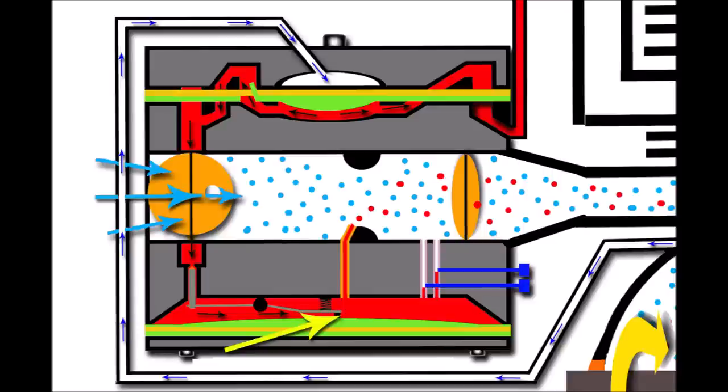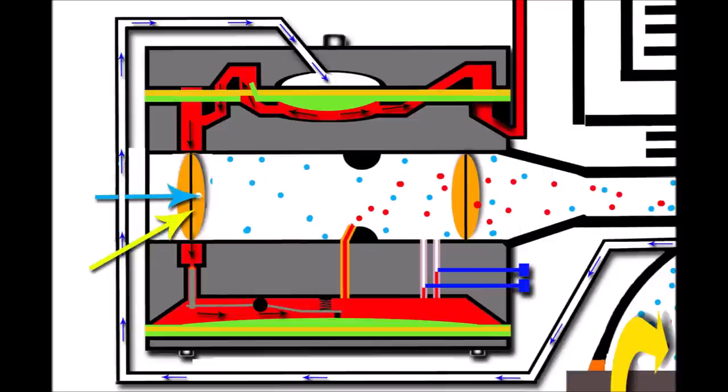This can happen if the diaphragm is slightly torn or ripped, or has gone stiff over time — the expandability of diaphragms can falter. That partial movement means fuel can't get past the needle valve efficiently because the valve won't come back far enough. The result is too little fuel going into the inlet, causing bog-down. When we hear that bog-down sound and turn on the choke, the increased vacuum in the inlet helps pull out more fuel. As more fuel leaves the metering area, it helps pull the diaphragm up a little more, pulling the needle valve back further, allowing some more fuel in and into the inlet.